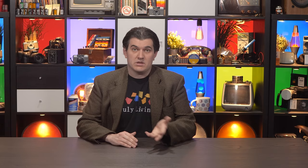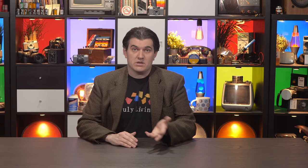But there's a wrinkle. Water in the air condenses on cold things. And because a refrigerator's evaporator gets so cold that you can make ice cubes, that wet water turns to the solid kind and ice builds up on the evaporator with time. In ye olden days — and in fact to this day with many mini-fridges and chest freezers — this was just a thing you had to deal with. Every once in a while you'd empty out your fridge, shut it off, leave the door open, and let that ice melt. Or maybe stick a pot of boiling water in there and shut the door if you want to speed it up.